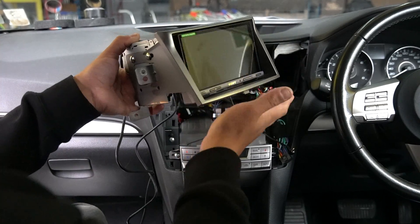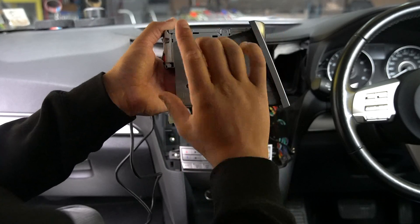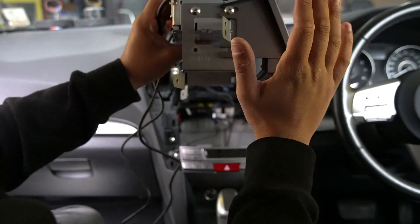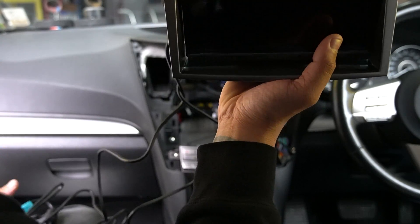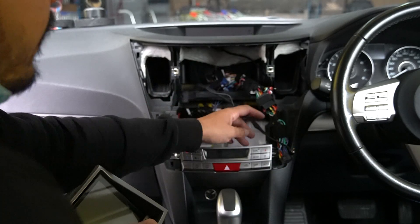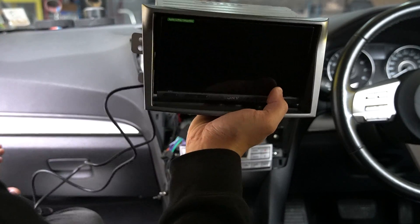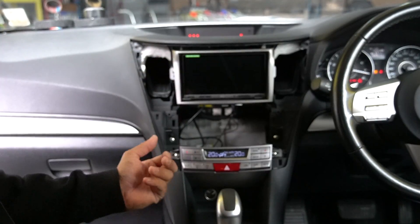The new fascia has arrived and is built up - it simply slides onto the radio. This is a single DIN chassis, so the bottom screw holes won't be used. The bracket came off the factory radio; just unscrew the Phillips heads, transfer the left-side bracket, line it up with two of the bolts, and the fascia slides on and screws in securely. Run the USBs into the glove box, then plug in everything: steering wheel controls, microphone, power, and the antenna adapter.